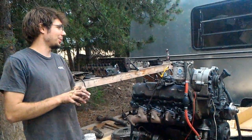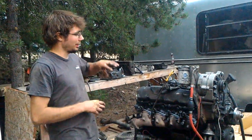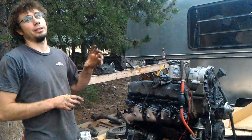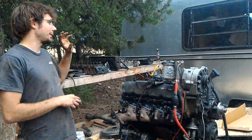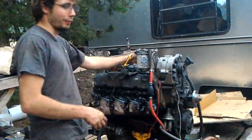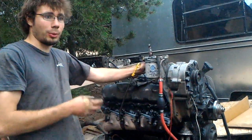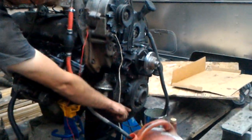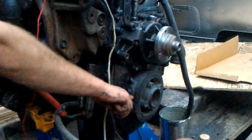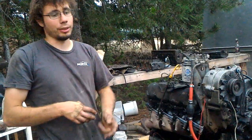But it was smoking. It wasn't running quite right. Well, as it turns out, somehow I managed to have it 180 degrees out. So, 360 degrees of crank rotation, or 180 degrees of cam rotation. Not entirely sure how I managed to do that, but I put my finger over the glow plug hole, cranked the engine over by hand, feeling for air coming out, stopping on top dead center when the mark lines up, just after I had been feeling air coming out, which means it's under compression. So that would be top dead center firing stroke.